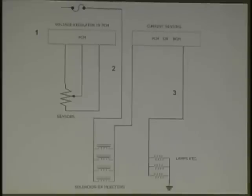It'll come back again. How many of you guys have ever had an EGR position sensor, very common on Fords years back, cause a no-start issue? You disconnected it, and all of a sudden the vehicle started up. A little tip that you should always think of: if the vehicle doesn't start because of this current sensing, disconnect each 5-volt reference one at a time. If it starts up, that one you just disconnected, try it after each one. That's the one bringing it down.